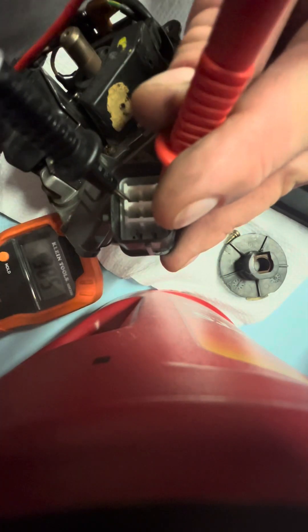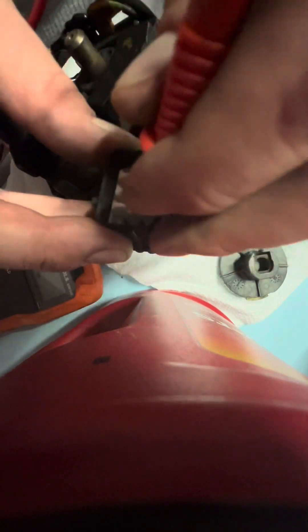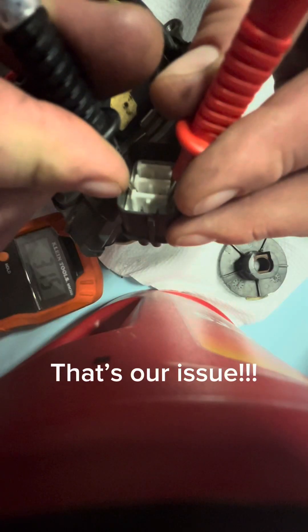385 — that's above 350, so that's good. The next check is going to be the TDC, which is terminals 3 and 7. All I have to do is move this over one terminal on each side. This should be between 350 and 700. We can see that one's a little low.